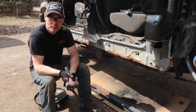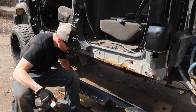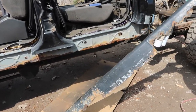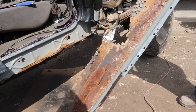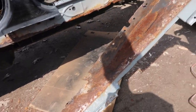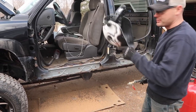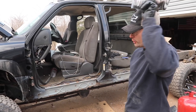I don't recommend this job to anybody — that's all I got to say, it's not fun. I think it's still good though, we could probably put this on eBay and sell it. It looks pretty rusted out — rust city — and that's where it goes, from the inside out, that's how it rusts. This is the sandblaster we're using — walnut. I already hit it up pretty good but I'm just scaling it so we can get a nice smooth surface to tack these new rockers in.